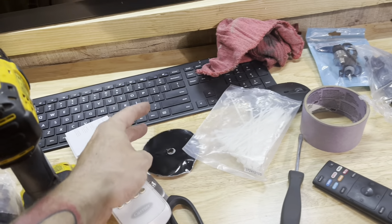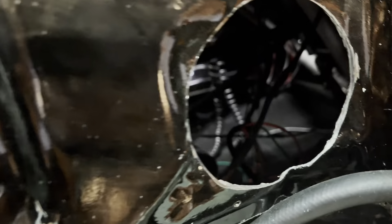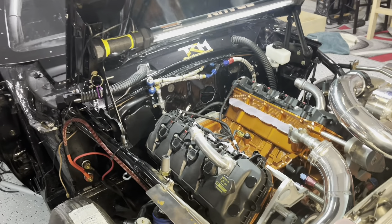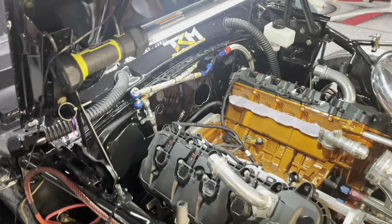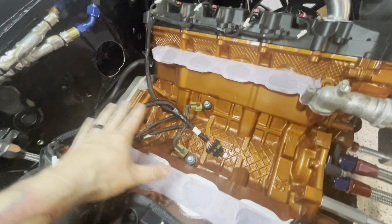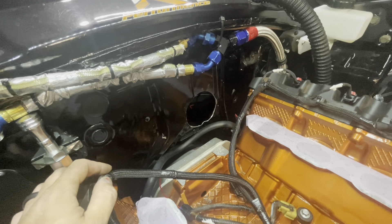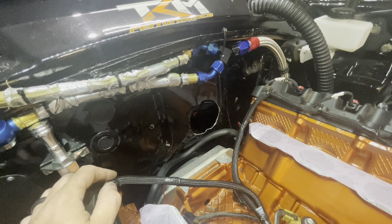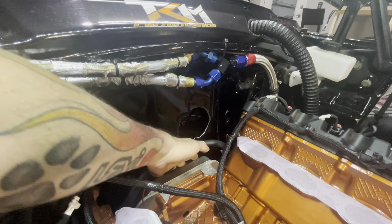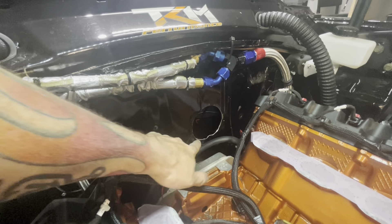I'm not dealing with that right now. We've got a nice hole here — it's just inside the car and I'm very happy with it because I don't like tight spots. The harness is going to go through there. For anyone from TKM watching — I covered and taped everything up so I don't ruin your beautiful masterpiece. I'm not a big fan of buying bulkhead connectors, so we already have a hole drilled through the firewall to get to the transmission bolts, and we built a patch panel in another video that bolts on from the inside with a rubber seal.